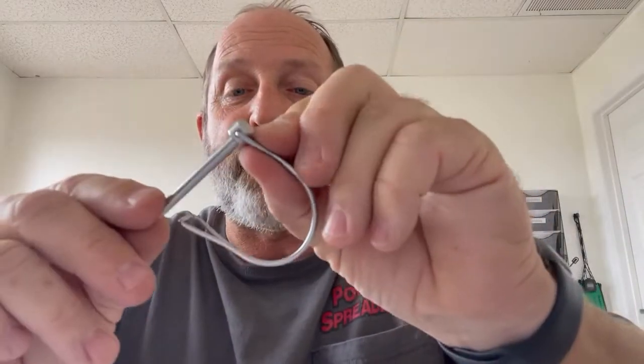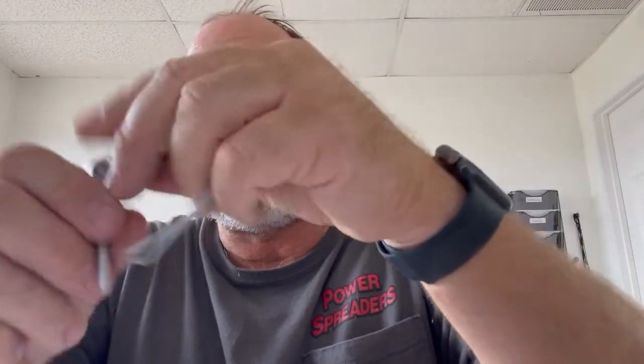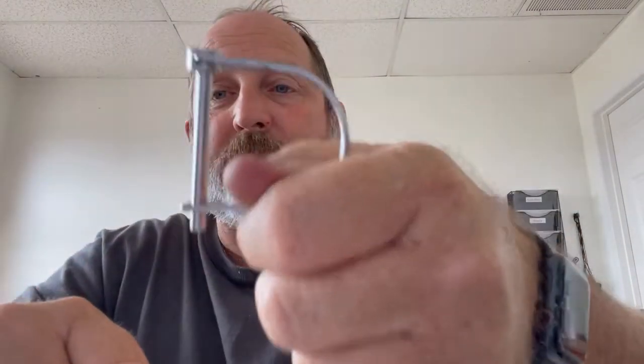So I ordered some in, started trying it, and I really like it. I use something similar in my tongue on my trailer every day and it never even dawned on me. It's a safety coupler — I always use them to lock in the hitch on my trailer. It's three-sixteenths, same as the cotter pins — three-sixteenths, 1.97 inches long, basically two inches, stainless steel. It's called a shaft locking pin and it goes right in the axle, right through the wheel, and you clip it.